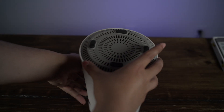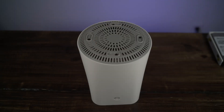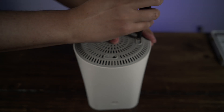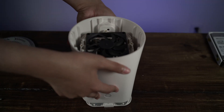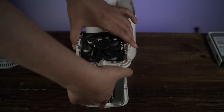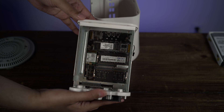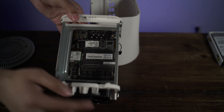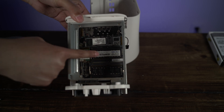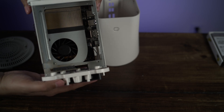There are four rubber pieces covering the screws at the bottom — remove them to access the screws. Once you remove the bottom four screws, you can remove the outer shell of the NAS. Once you open it, you get access to all the hardware inside. You can replace the included NVMe drive or add a second one. It has replaceable dual-channel RAM with a maximum capacity of 64 gigabytes, a replaceable Wi-Fi card, and a nice heat sink and fan for cooling.